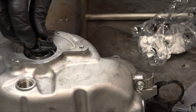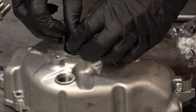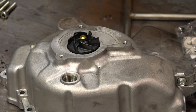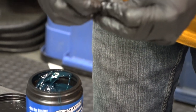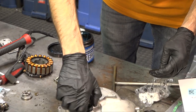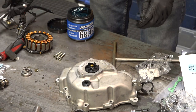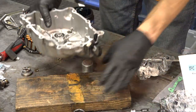Just thread the impeller on and we'll tighten it — remember to tighten this when we put it all back together. We've got a brand new impeller. When it turns, that's normal — it has some friction, especially with those brand new seals. I'm going to go ahead and replace this O-ring, part number 479986, on this inspection plug before reinstalling it. Just roll the O-ring onto that plug. You don't need to tighten it all that tight. The water pump is all built.